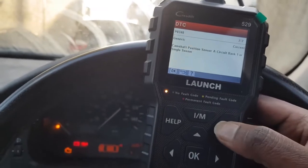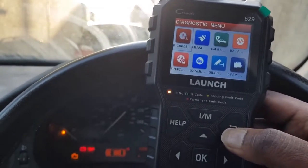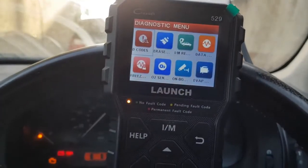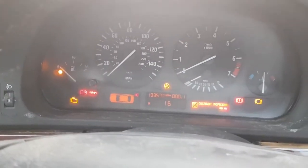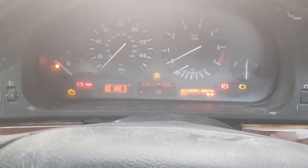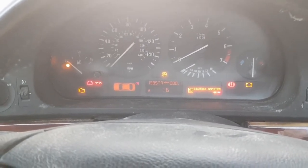So it is literally going to have to be one of those deal with these errors one by one. The first port of call is to just change the rear lights, because you can see that really on the steering wheel. There, it's pointing to a rear light, and then we're going to do an oil service. So change the oil filter, replace all the oil, change all the fluids in the car, brake fluid, power steering fluid, and then have a look at those sensor problems.